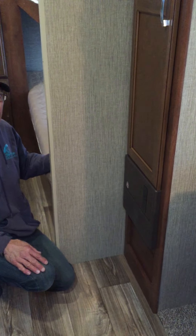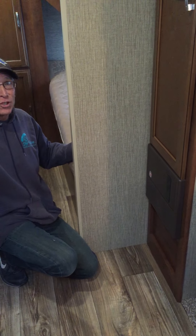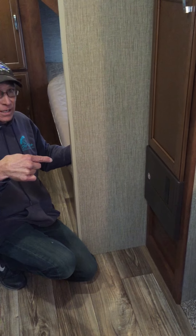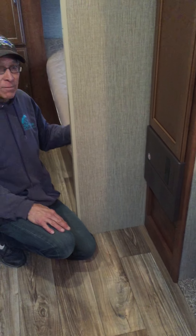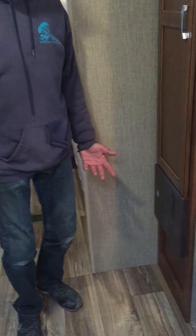The problem is the awning — you can't leave that on. You'll have to have someone push the button while you look, and then the light will show up if it's a bad fuse. I wedge my knife in the button because if I'm working alone I'm not going to call someone over just to push a switch.